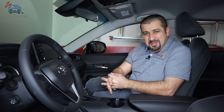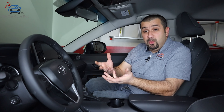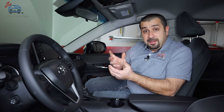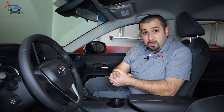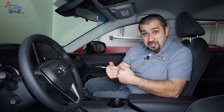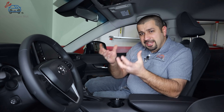Let's talk about the coveted EV mode — the one people often don't understand or don't see the point of. EV mode will put your car in electric-only operation. The car sometimes goes into EV mode on its own when the battery is fully charged, the engine is warmed up, and you're stopped. Toyota's idea of EV mode is for situations like driving through your neighborhood in the morning without making noise, or being in a closed parking lot with poor ventilation where you want zero emissions.